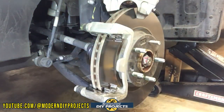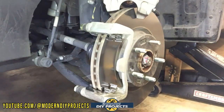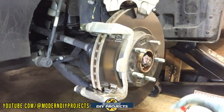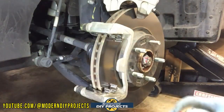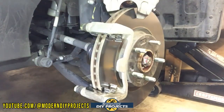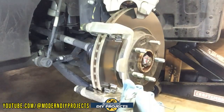This procedure should apply to any Hyundai, but for certain it applies to the Tucson 2016 and newer. Pretty much everything after this should be the same until the new body style around 2019-2020. Be sure to clean these little springs that come with it — you can reuse them. The kit I got from O'Reilly's did not include these little springs, so I reused the old ones. In fact, if you get brakes without hardware, you can reuse the old hardware — sometimes you just have to.